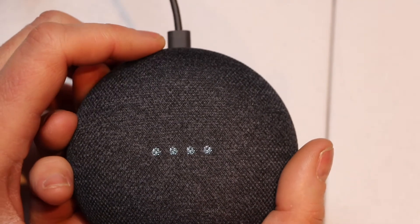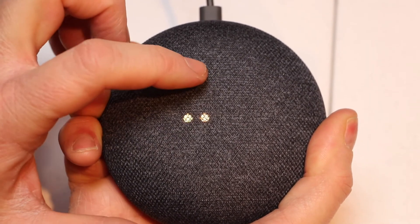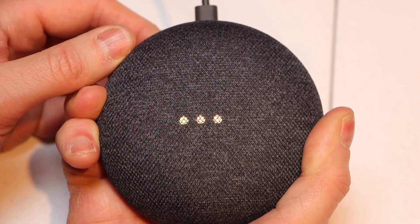I'm going to flip it back over and push the button. It'll light up orange — you're about to completely reset Google Home. To cancel, release the button. Once it gets to four, it will reset and you'll hear a little chime.